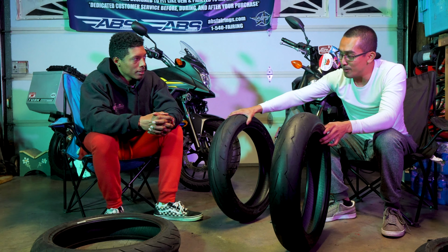it's made for. It's not made to commute. I don't know why you would buy this tire. This is way more expensive than the Q3. Why you would buy this just to commute? You're a fool. But this is really geared towards more just a track tire. Even if you just look at the tread, the wear bars look like they're already about to hit, and it's a brand new tire.